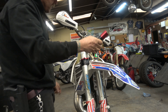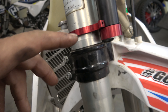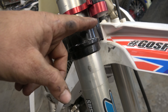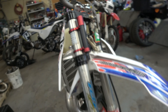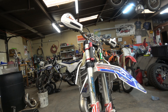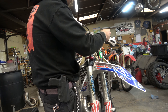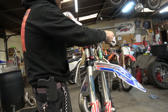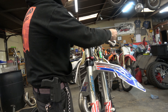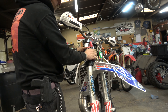Here's the Counter Shox. What you want is the big red piece up and the smaller piece down. We're going to get it as far down, as close to the top of the triple clamp as we can. Like all things with multiple bolts and bolt holes, you want to install everything loose to start so you can move things around, and then once you get it where you want it, you can tighten everything down. So they're all still a little bit loose so I can rotate and move this thing.